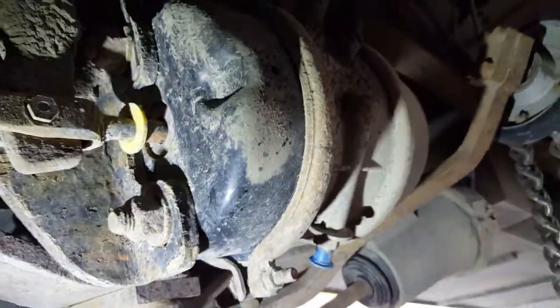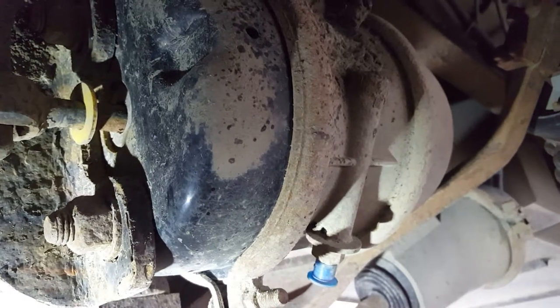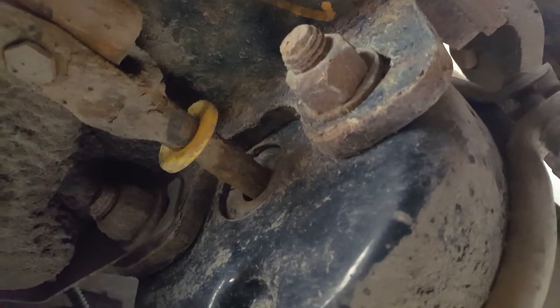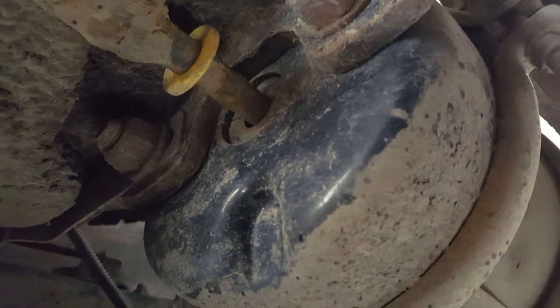You can see the push rod stroke from this side — the driver's side — compared to the passenger side. We're not getting the same travel, it's not balanced. The distance of travel in the spring pot wasn't even on both sides. So these pots are going to be replaced.